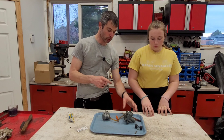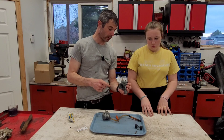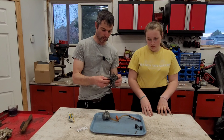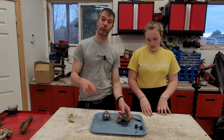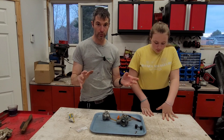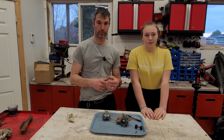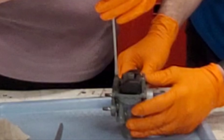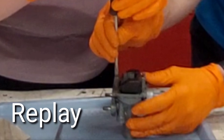If you guys remember in the last video, we had a bit of an issue with the air screw. We found out that there were some parts missing — the air screw didn't have any spring to hold it in place, so it was actually able to migrate its way out. It also didn't have an o-ring or the little washer, but we purchased a whole new set from our local dealer.